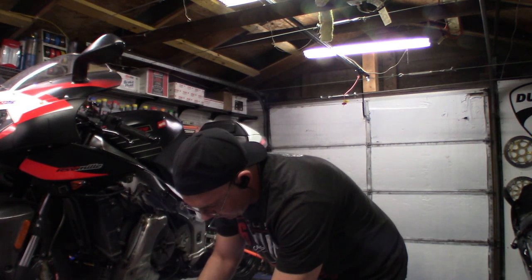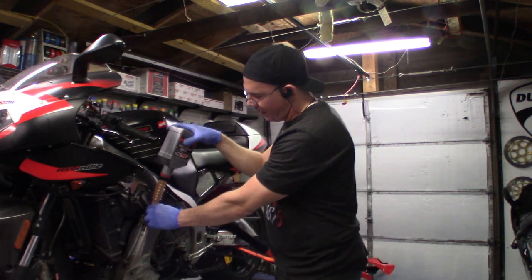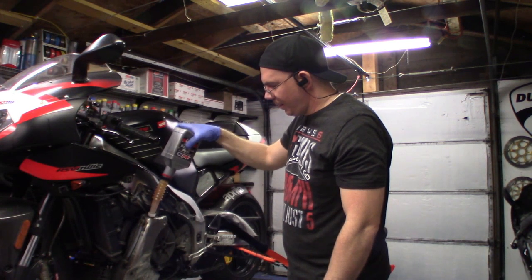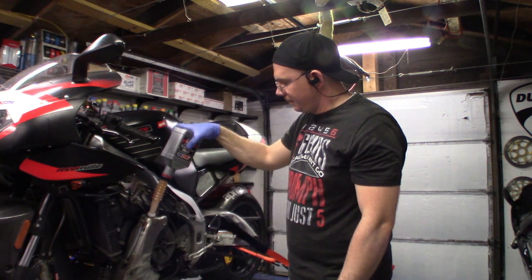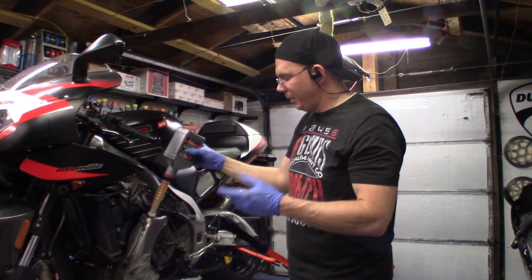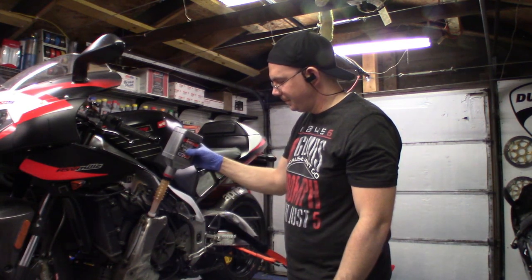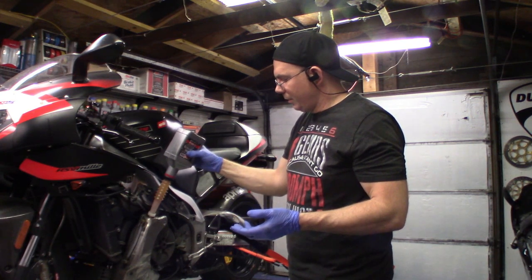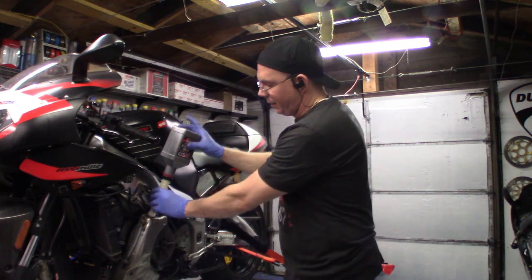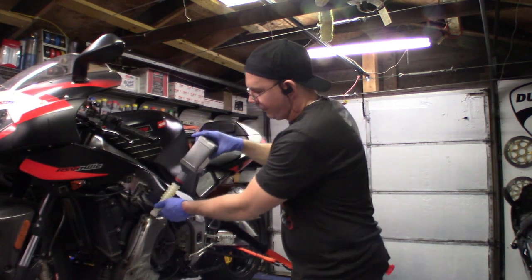I don't believe in carbon tax and all that, and I'm not generally a big fan of recycling, but when it comes to oil I am a big fan of taking it and getting it disposed of properly so it doesn't contaminate everything. Just take your time filling this. Instead of dumping all four quarts in at once, I'll put about three and a half quarts and then run the engine to let it cycle through. If you're changing oil on the kickstand the bike will be tilted — get the bike vertical and sitting straight to check your oil level, because on the kickstand you won't get a proper readout.